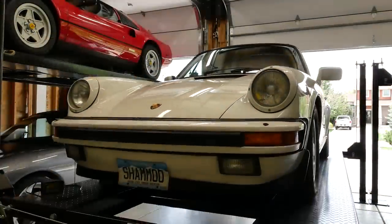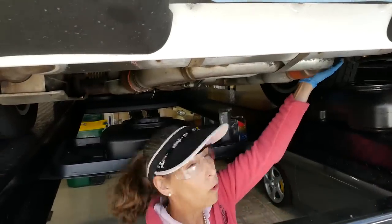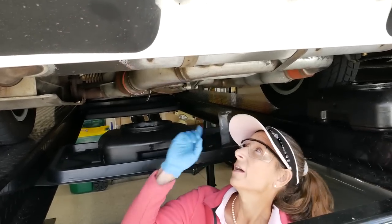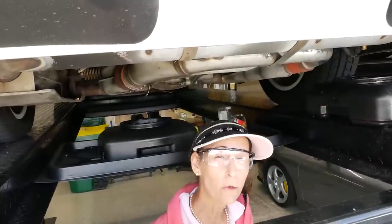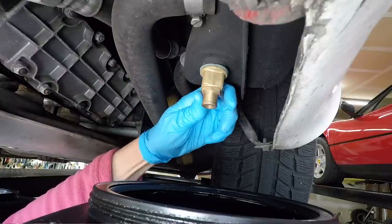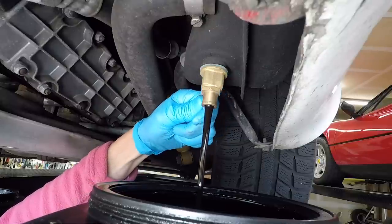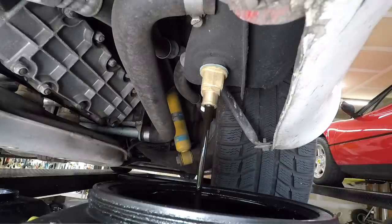Let's get to draining the oil. I'm going to start with draining the actual oil tank. 911s are funny — these air-cooled cars are dry sumps, so we've got a drain on the engine and we also have an actual oil tank over here. I've got one of these cool quick-drain things — it's pretty simple. All we have to do is pull our little tab forward and then rotate this guy down. And that's all we have to do — super easy to drain this.